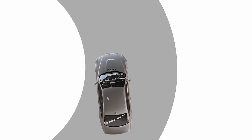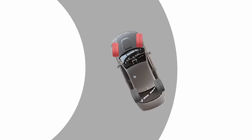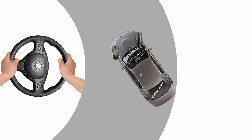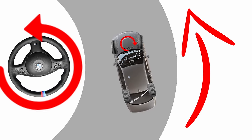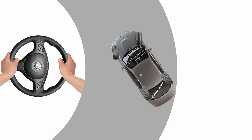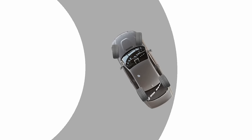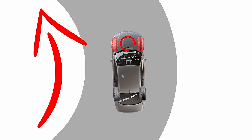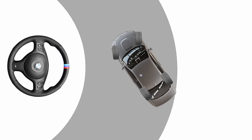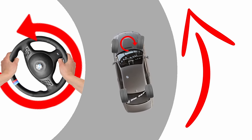When the car starts to straighten out or when it is decreasing its drift angle, it starts to rotate around the front axle in the opposite direction of the turn. Again, the front wheels will want to keep pointing at their current direction. If you let go of the steering wheel at that moment, it will rotate in the same direction of the turn, reducing the steering angle of the wheels. If you keep holding the steering wheel, you will feel a light force that wants to turn it back to center. So if you're drifting a left turn and your drift angle is decreasing, releasing the wheel will turn it left, reducing the counter-steering, and holding it you'll feel a light force wanting to turn it left.